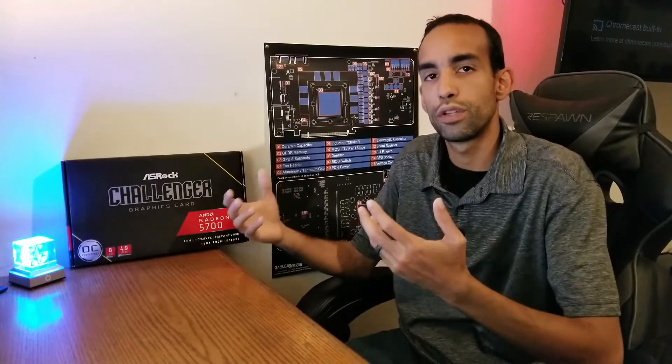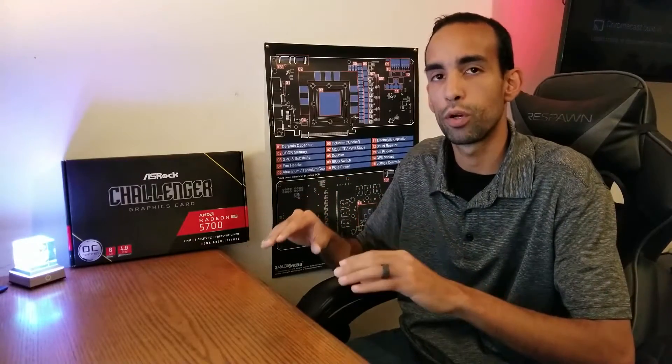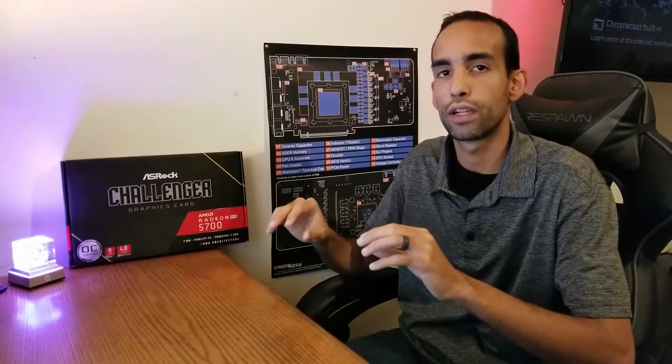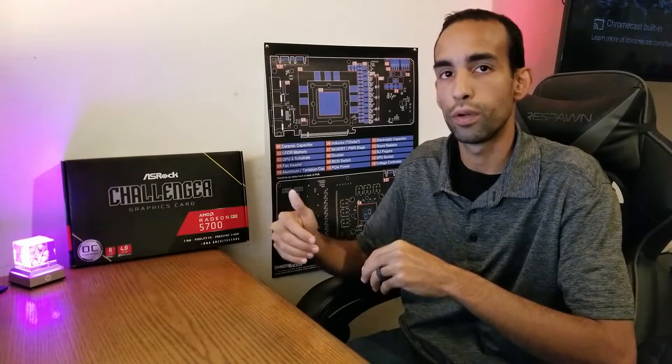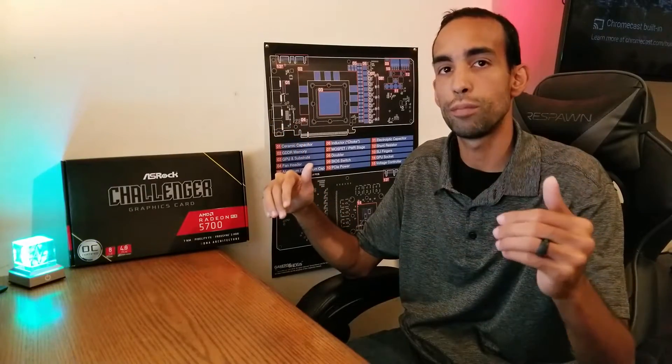A few days have passed and I had time to play around with this card. The ASRock Challenger 5700 is perfectly capable at doing its job for its intended purpose — gaming. You don't have to mod it; it's perfectly capable at gaming within spec. However, one of the biggest reasons I did this mod is because of memory-intensive applications like mining Ethereum, where I was seeing 104°C on the memory modules, plus overclocking using soft power play tables or More Power Tool is increasing thermal output.